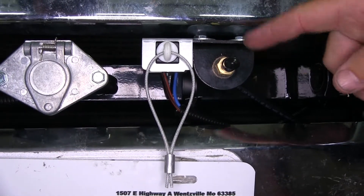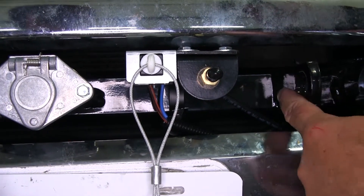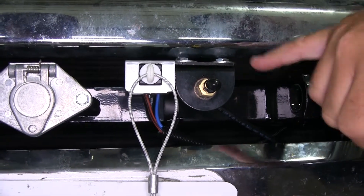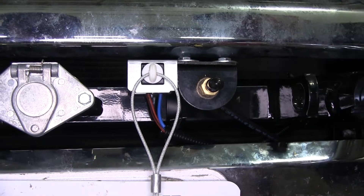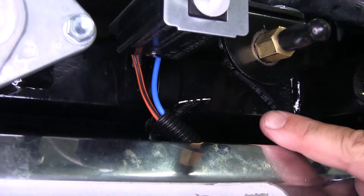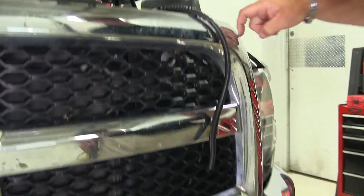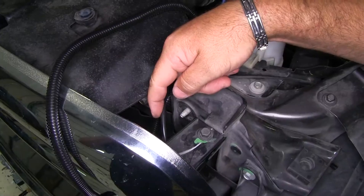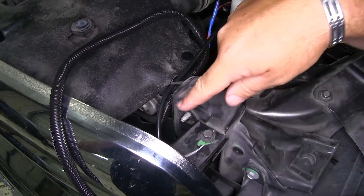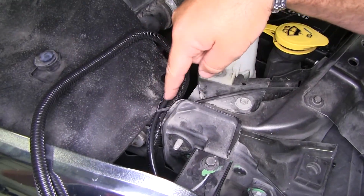So this is what I did. My air fitting and my breakaway switch — with the long bracket I advise you to use — I mounted to my base plate. I cut it down so it sat even with the edge of the bumper and drilled a couple of holes to mount both of them side by side. My orange wire with the black strap, blue wire coming off my breakaway switch, and my airline tube — I ran them right up behind my base plate, behind my grill. I came up right through here, so this is my airline tube and my blue, orange, and black wires running right through my wire loom.